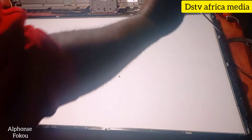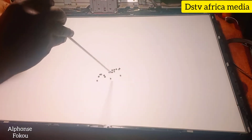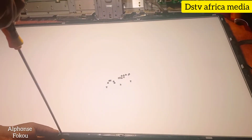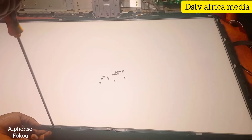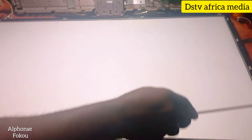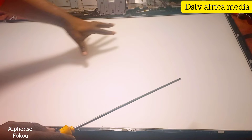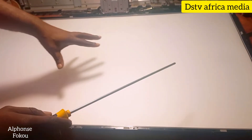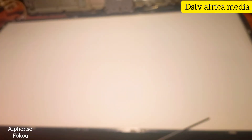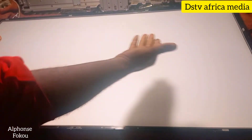Now all these screws — we're going to close the frame. The frame will be secured with these screws. Stay tuned until the end of the video. We've now put the whole frame together with all the screws — it's very tight and clean. Make sure there's no dust, because any particles will appear on the screen. The frame is now prepared to receive the LCD.